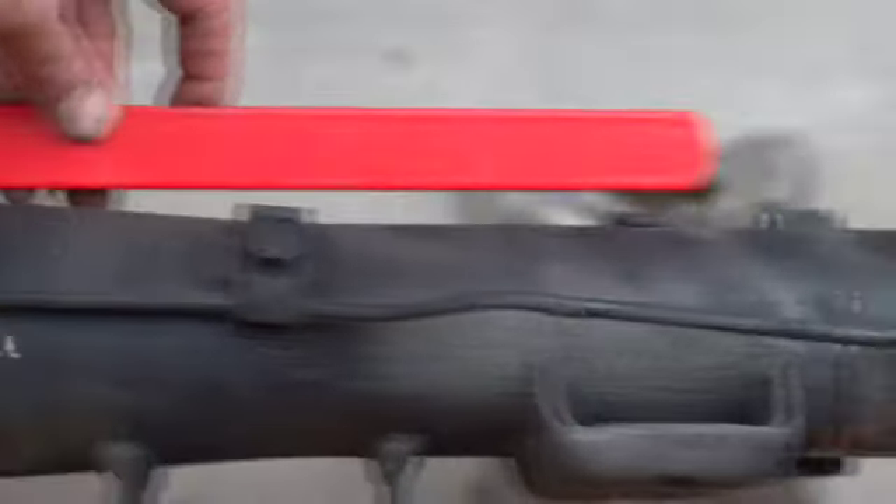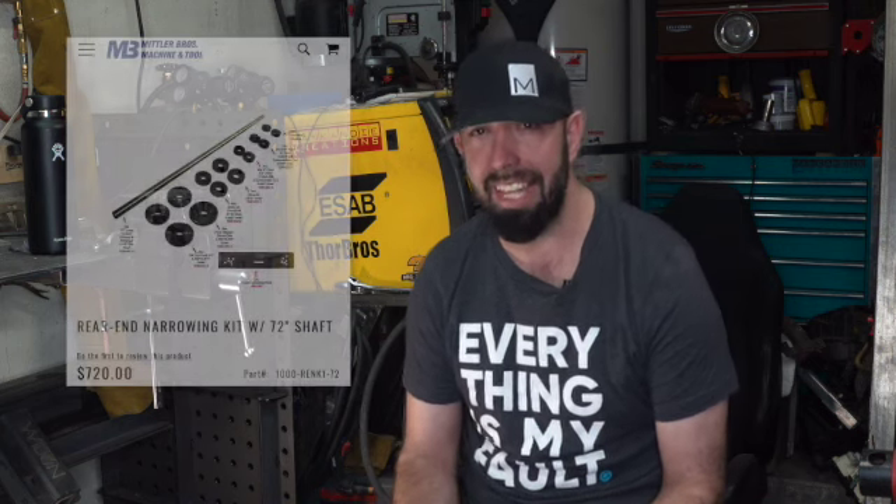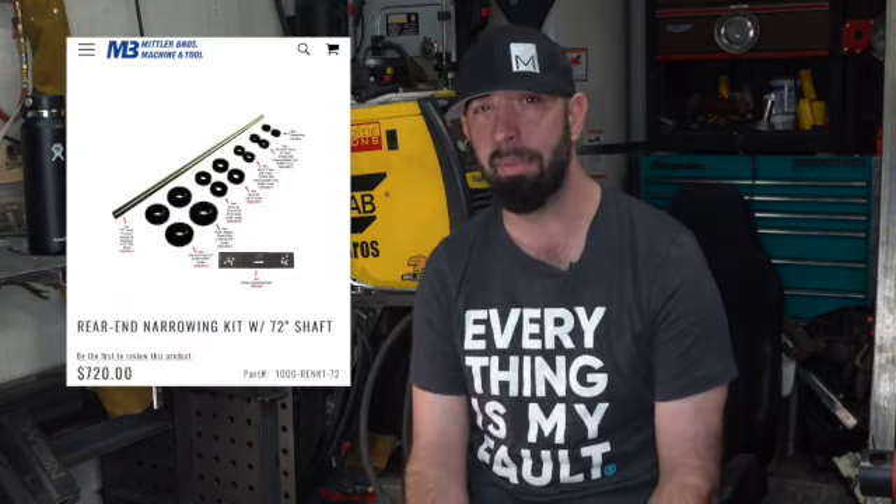If you've still got your heart set on narrowing that Mighty Max axle, let's continue. Take a look at the axle housing. It's important to notice that the axle tube is not a consistent diameter, and that's going to cause problems when shortening. The diameter changes on the Mighty Max axle housing make it pretty much impossible to lay flat in a jig, which means the external jig we used in the previous episode is useless here. Our only hope for a precisely shortened Mighty Max axle housing is that internal bar jig we discussed in the last episode. The problem will be finding machined parts that fit into the ends of the Mighty Max axle housing — they may exist, but you're more likely going to need to purchase the bar and have the machine parts custom made. Unless you own your own machine shop or have a machine shop friend, that's likely not going to be cheap.